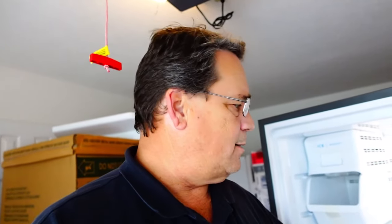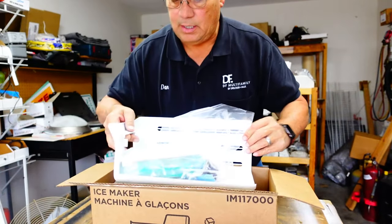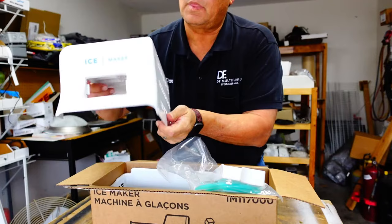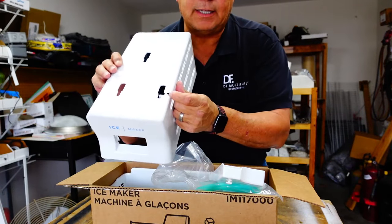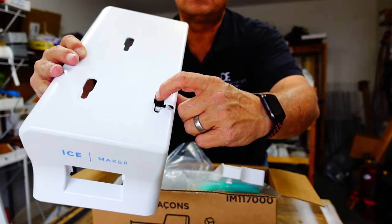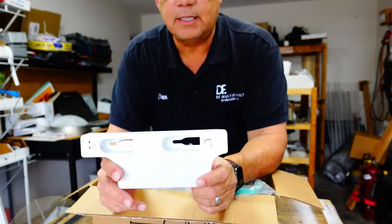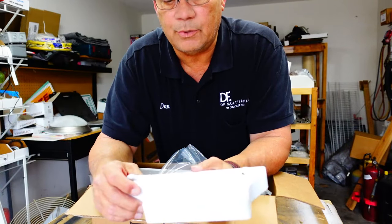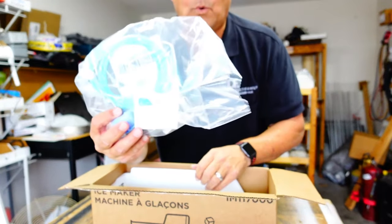So what I've got here is the new Frigidaire ice maker — what comes in the box. I'll show you that piece that covers the front of the ice maker. It just has those three clips or studs on the roof of the freezer that hold this in place. Don't forget when you take this out you've got to stick a flat-headed screwdriver in here just to pull that tab in a little bit, enough to where you can slide it past the head of the post. That's the new one. This is the sidewall piece that the ice maker slides into — this is for a refrigerator that didn't come with an ice maker, so you would need all these pieces to install it. That's part of the kit, along with the water valve and the water tubing.